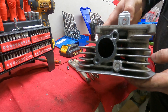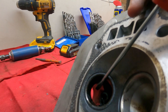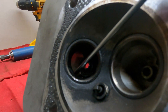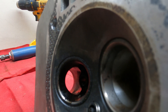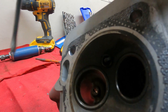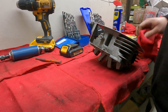The top is where our broken stud was — it is drilled and tapped back out to the original size, looks perfect. Our main goal now is to blend this into the valve seat, essentially creating a smooth transition across, and then open up both the exhaust and intake ports. The biggest thing is cleaning off these sharp edges inside the cylinder head to create a smooth transition all the way down. You can see the sharp edges coming in on the intake side — we can blend all of that out and open those up to create better flow. I'm going to grab my die grinder with a carbide bit.